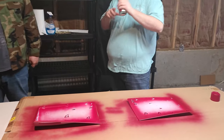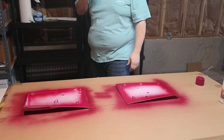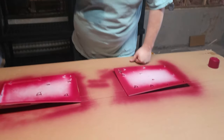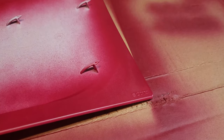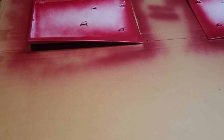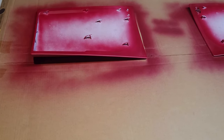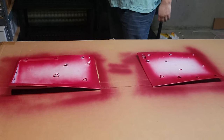Well, that was about 10 minutes. Let's go to a second coat. So, once again, you gotta shake her up good. As you can tell, this coat took on really well. There's some funny stuff going on with the molding here. That's not the paint. When it's all matte textured white, you kind of don't see that until you start putting a high sheen layer on it. Which has me semi-nervous for the other side, considering we're using a high gloss instead of a matte clear or a satin clear.